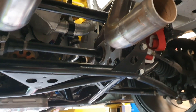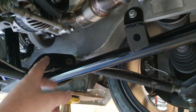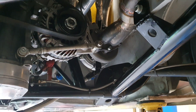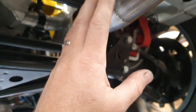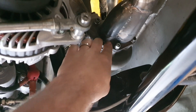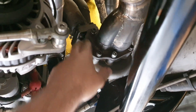With the previous installation, I had the tail pipes — exhaust pipes — bolted directly to the turbos with no flexible couplings or anything like that. They're only about one and a half meters of pipe, and there was nothing supporting anything; it just hung there. That was actually terrible, but it worked. Obviously, as you'd expect, it gave those bolts a very hard time, so I had to keep an eye on them to make sure they didn't stretch and work loose, same with the bolts holding the turbine onto the manifold.